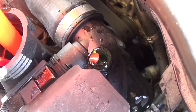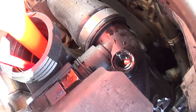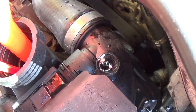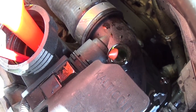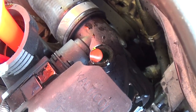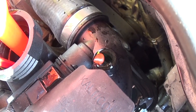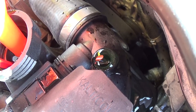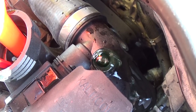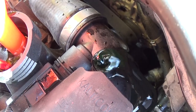By having the key in the second position, it's circulating the coolant through the cylinder head, and this bleed point is the upper point. You can see we need to add a little bit more — there is still more air coming out. You might think it stops but it doesn't.